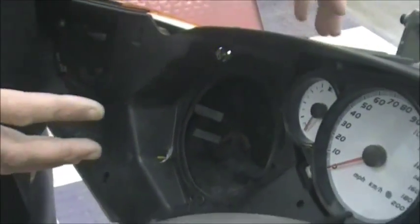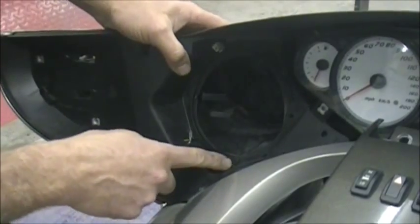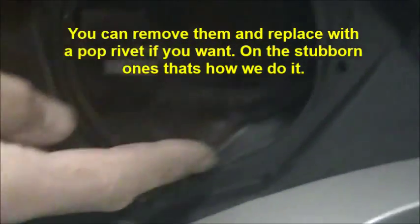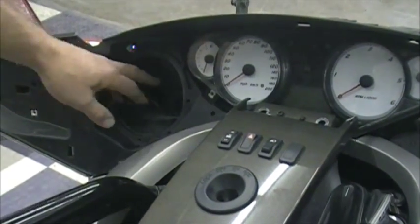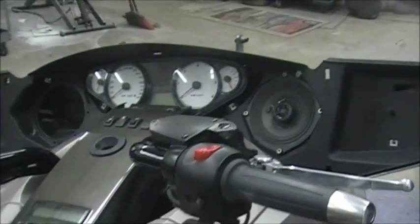It's a little difficult depending on how big your hands are — you have to push that wire through and get it out of the box. There are some little push-pin rivets here that hold the box on. If you need to loosen the box up, you can pull those rivets out. You can see where somebody previously tried to heat and melt the speaker box trying to fit bigger speakers. If you do that it can work, but a lot of people blow a hole through and melt it too much, which distorts everything — it's just more trouble than it's worth.